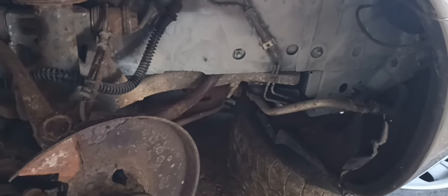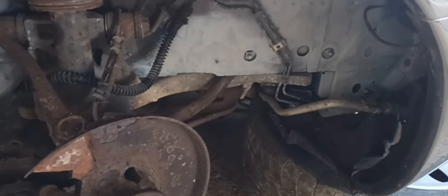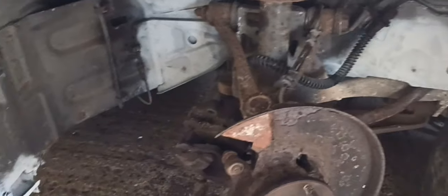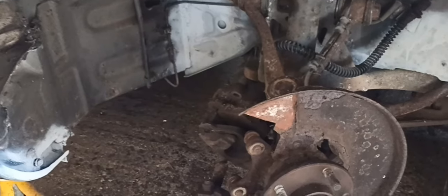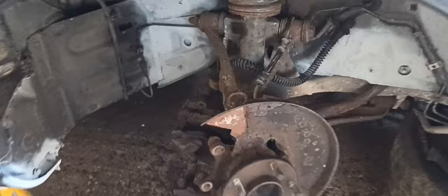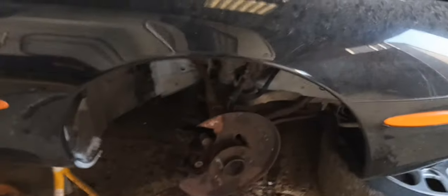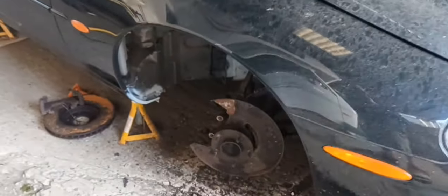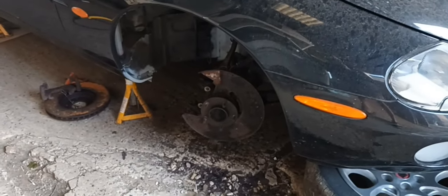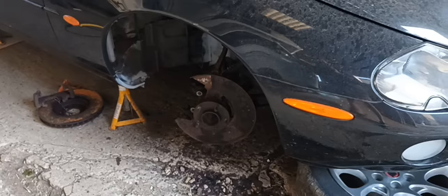And then I put some Bilt Hamber rust treatment on there, Hydrate 80. And I'm just throwing a bit of primer over it to protect it until we do our urethane Raptor liner all up inside there, to give it a nice textured finish. We're taking all the brakes off, going to clean them all up and get brand new brakes on there and go from there.